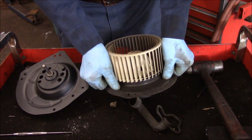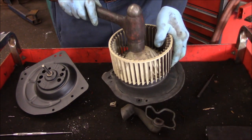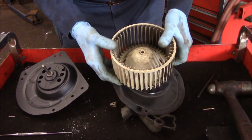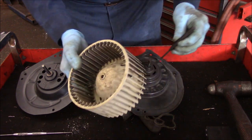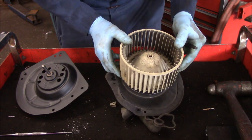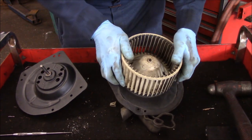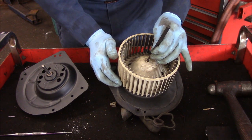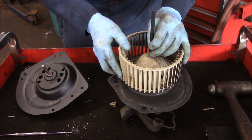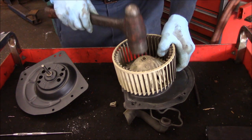This one is going to come off — it's moving, just a little tight. What you can do is just tap lightly, just like that to get it to move, and this one actually came off. But if it didn't come off, you would get in here with a center punch, put it on the top right here, hold it up, have your assistant tap on top, and it'll pop right out. But it came out fairly easy.